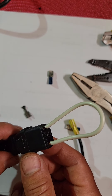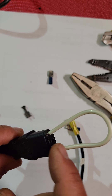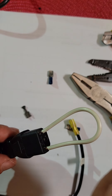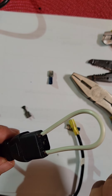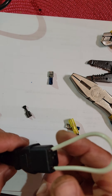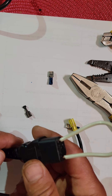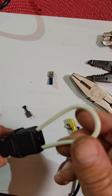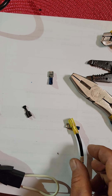In a Westphalia example with the pink wire, you would look at the center terminal and jumper it to the black and yellow wire. Then you'd be able to go and turn on your light switch and see if it turns on your lights. If that doesn't work, you know you've provided power to the switch, and the next part is probably a ground problem.